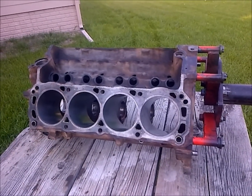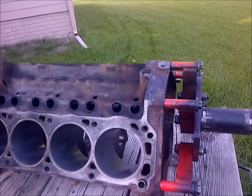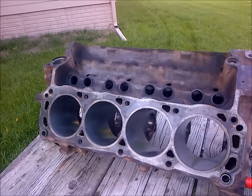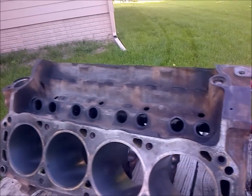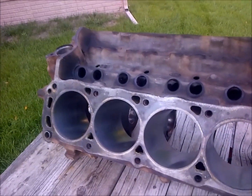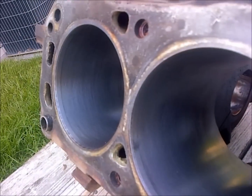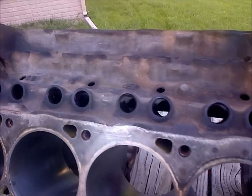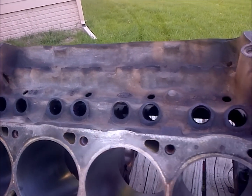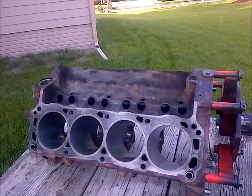We're about ready to get this 302 block all cleaned up — get all the grit and grime out of the internal parts of the engine as well as off the outside so it will paint up real well. I already went ahead and partially cleaned this motor up because it was just so dirty. You want to make sure you have everything done before you clean it, such as boring — these bores are freshly honed with a stone hone and then a ball hone to finish. I also knocked out the cam bearings, so this block is entirely bare and ready to be fully cleaned before reassembly.